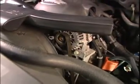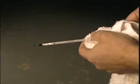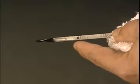Start the engine, let it run for roughly 1 minute, and visually inspect for leaks. Shut off the engine and check the dipstick again. Then add oil if necessary.